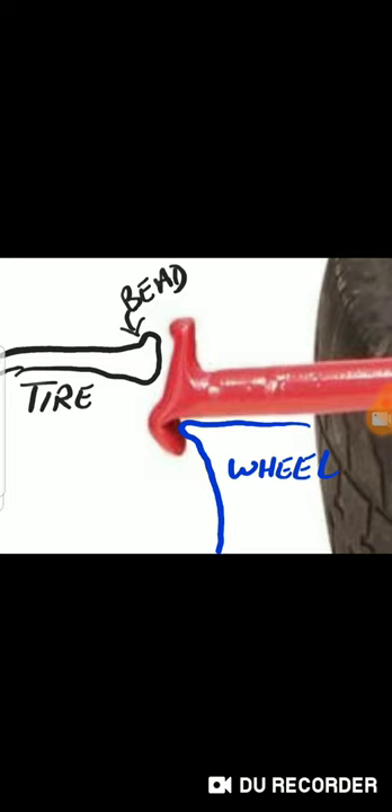Some wheels don't have a deep center groove, but all wheels are going to be narrower in the middle — you need all the help you can get. The bead of the tire is made to sit right on the bead seat of the wheel — it's basically a giant steel cable inside the bead. If you try to force it, something's going to give — you'll break the bead, stretch the bead, or break the rubber where the bead is. You can't force it on while it's sitting on the bead, or you're going to break something.